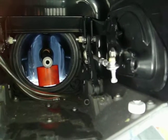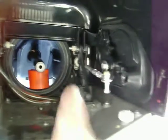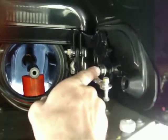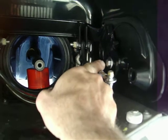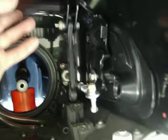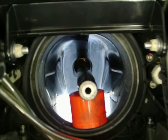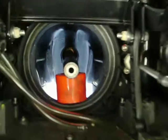This is the business end of my jet ski. I've successfully pulled the pump out — it wasn't really that difficult. There's only one bolt that wouldn't come out; I'm a bit concerned it could be stripped, but it just holds this bracket in place and I can pull the pump in and out without undoing it. That's the drive shaft and the inlet tunnel for the water.